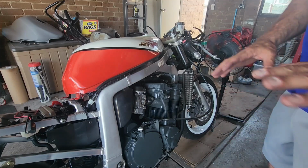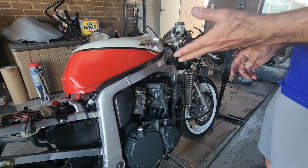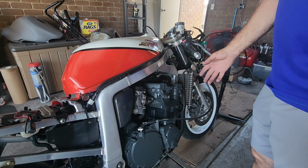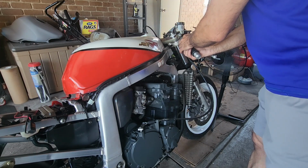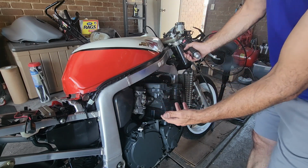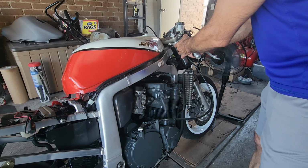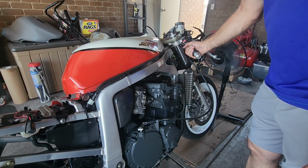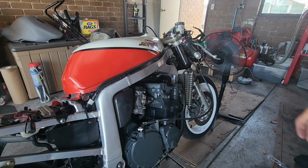And eventually I did the setup, put the fuel tank on, put the vacuum for the vacuum pump to start operating, put this one as well as the cooling fan, which doesn't do much, I know, but I'm not going to run it for much. It started just a while ago. I just managed to adjust the idle speed a bit because it was too high, and this is what I got so far. Running, and I'm very happy about it.